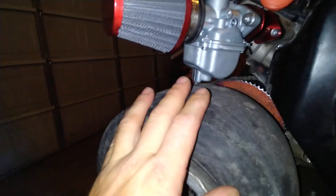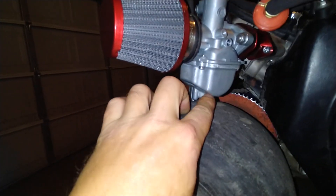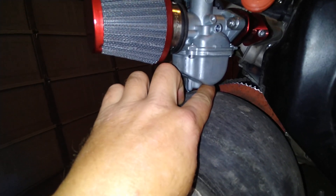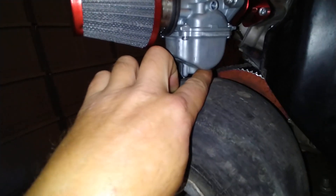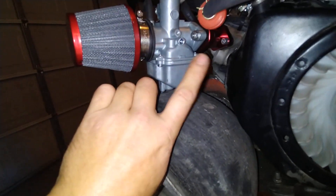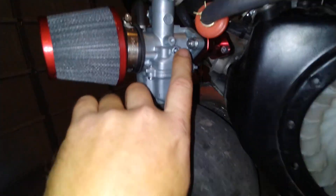What you need to do — I got to take off the wheel to do mine, or detach the whole carburetor. I'll just easily take off the wheel. There's an adjustment screw under here that adjusts your air intake. You need to tighten that to snug, and once you get it to snug, turn it back a turn and a half. That's going to be your setting for this Mikuni knockoff carburetor and it's going to work perfectly — no sputtering.